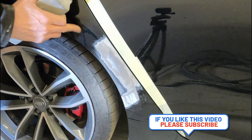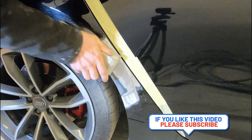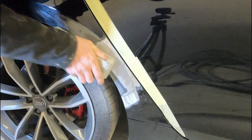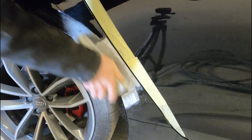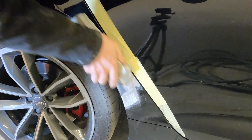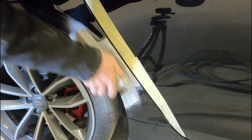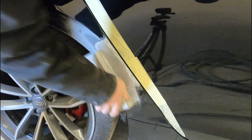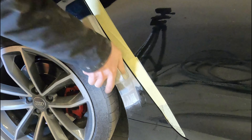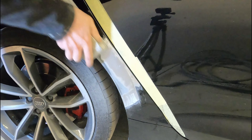We're then going to clean up the welding marks with the rotary die grinder again, and then we can get on to using a P80 to lightly block and blend all these paint edges in and basically blend this area in nicely so we've got a nice area to skim over. You'll also see at the top there's another little tiny low spot which we're going to get out when we give this a light skim.